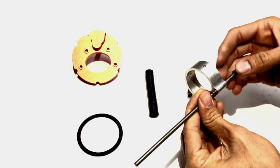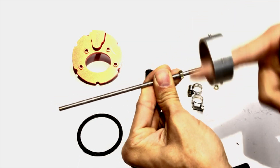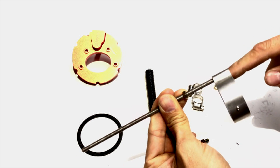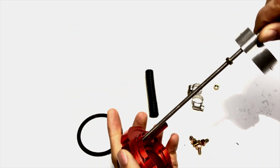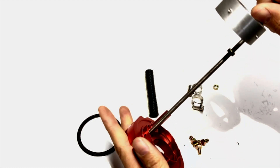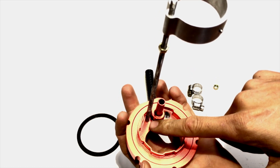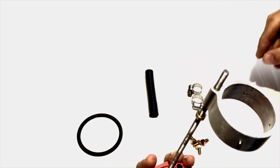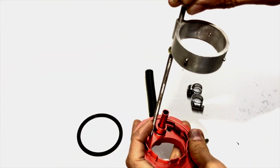So let's put this together — it's pretty simple. This pump is going to come disassembled and you're going to be able to just put it in here. Once you get this, you screw it into your rod like this, and then you'll take your rod and screw it into your pump plate here. We suggest you use thread locker when installing this rod — just put a little bit at the bottom. Once you tighten it with these two screws, you're pretty much all set.